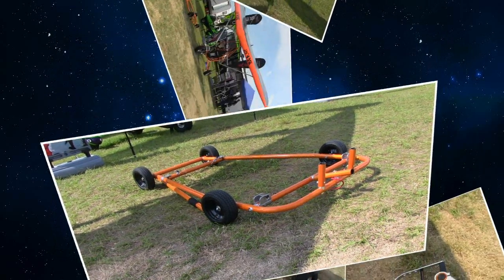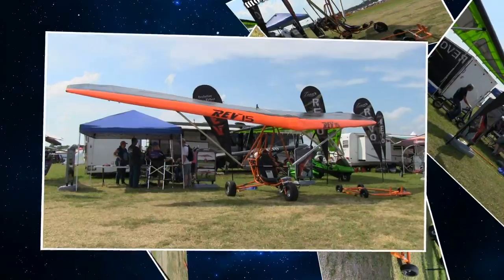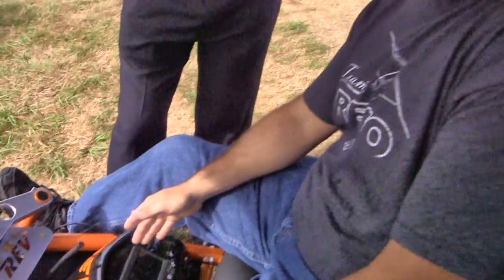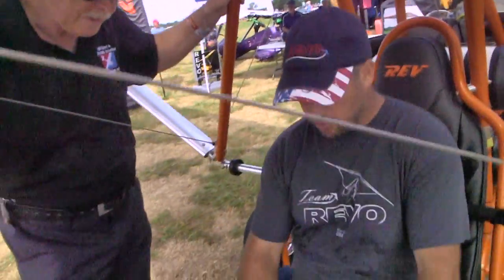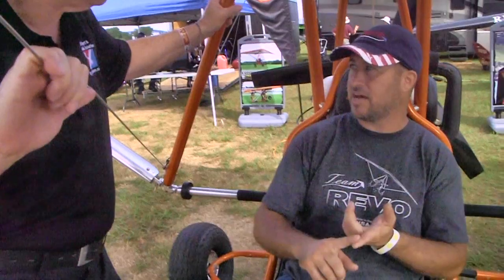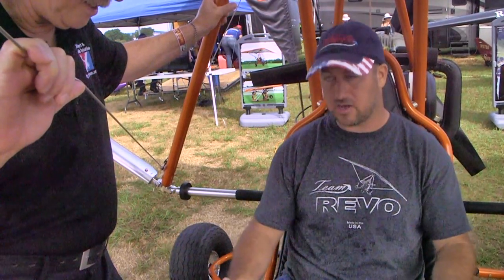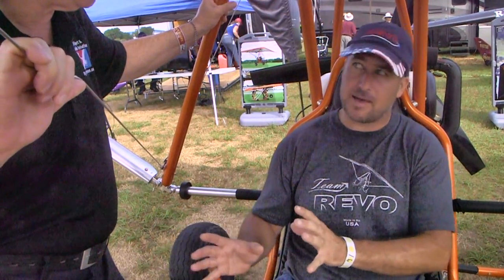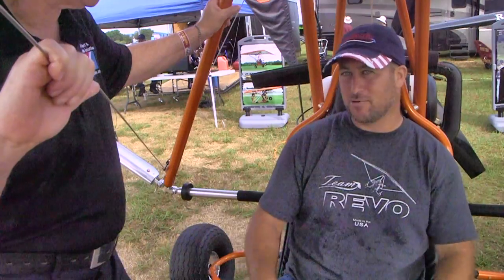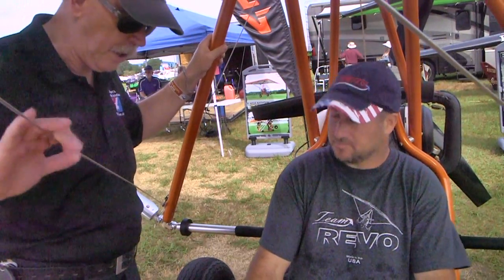You've got some nice instrumentation here. You've got a nice little screen down here, switches down here, but they're all out of the way — nothing to block your view. You can look down and catch the information. Whose unit are you using here? This is the MGL Extreme — this is an option. What normally comes is a digital CHT, a digital EGT with a tiny tach, which does not only tach but also your Hobbs meter. This unit gives you VSI, airspeed, altimeter, brilliant color, and it even has GPS — no moving map, but it actually allows you to plug in an airport and tell you how to get there. Not that you're going anywhere real far at 43 miles an hour. The MGL guys do a nice job, so I'm glad to see you using their hardware.